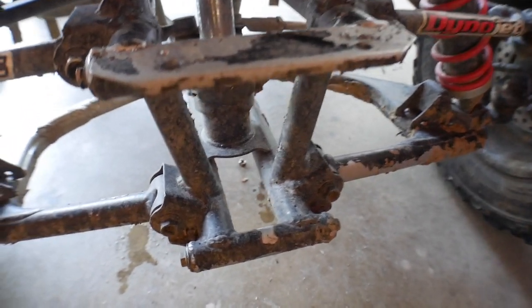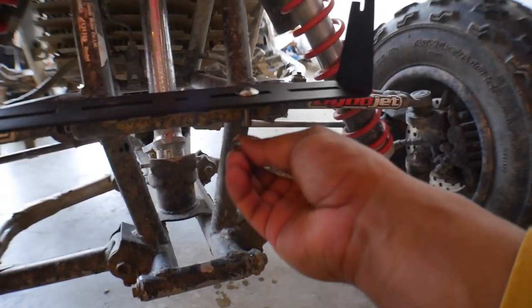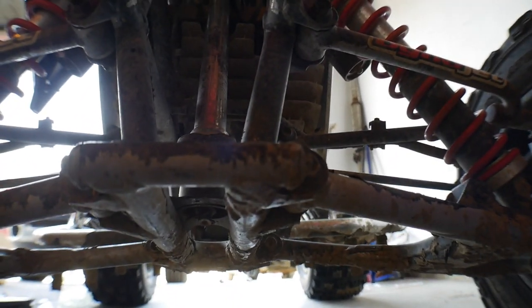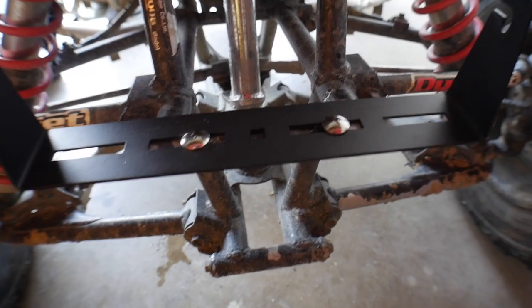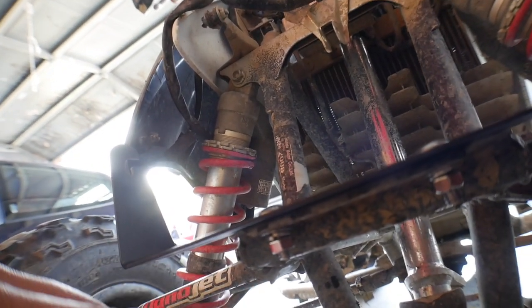Make sure not to drill into the VIN number. The screw fits perfectly. A washer goes under, along with a crush washer. The bolts go through the mount and from the bottom we have a washer then a crush washer then a nut. Now I'll get to tightening this up and then throwing on the light bar.